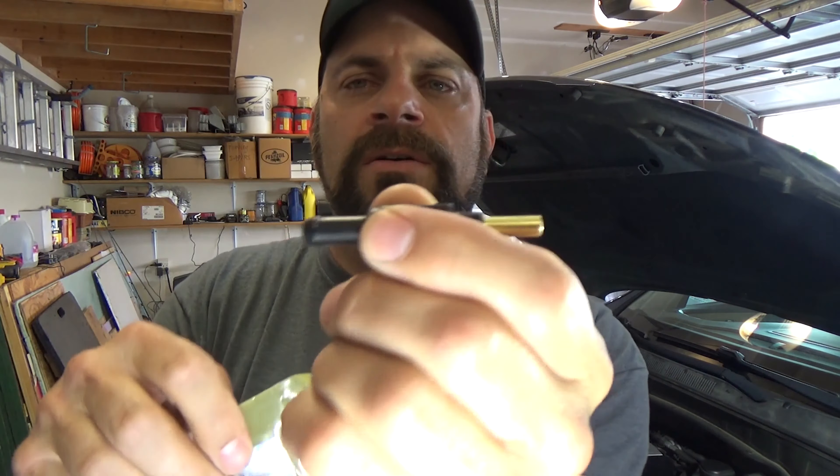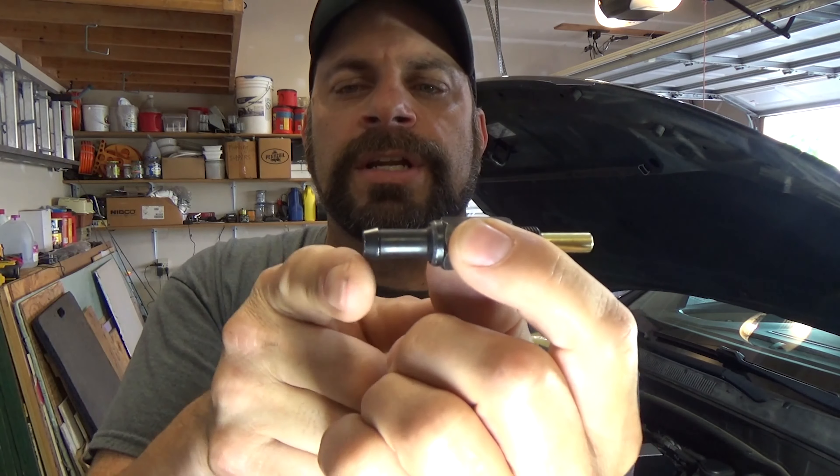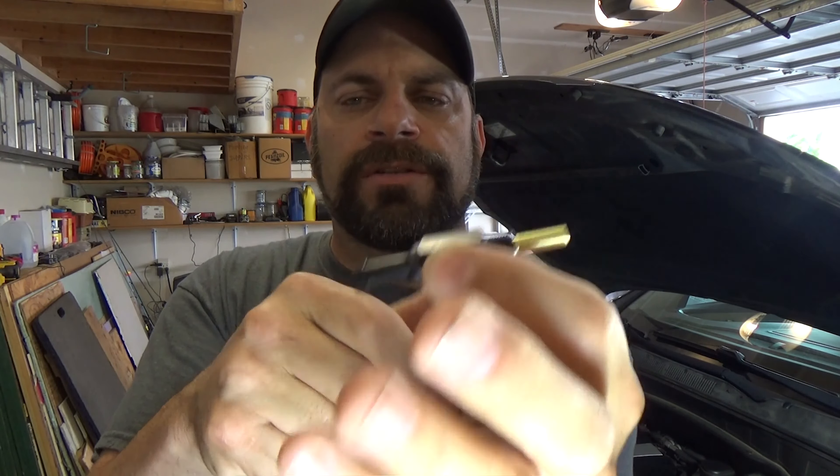Let me show you what it looks like. Basically, this one is metal and it's threaded on one end — screws in — and then the hose attaches right here. This regulates how much vacuum can pull through the crankcase. Inside the crankcase, fumes build up from combustion and you want to expel those fumes because they can contaminate the oil. If there's too much pressure, when this opens it releases pressure, so the oil seals won't have that pressure pushing it out, which can blow out an oil seal or cause oil to leak past it. It also regulates some pollution — instead of those crankcase fumes being released to the atmosphere, it's sucked into the intake and re-burned, which eliminates some emissions.